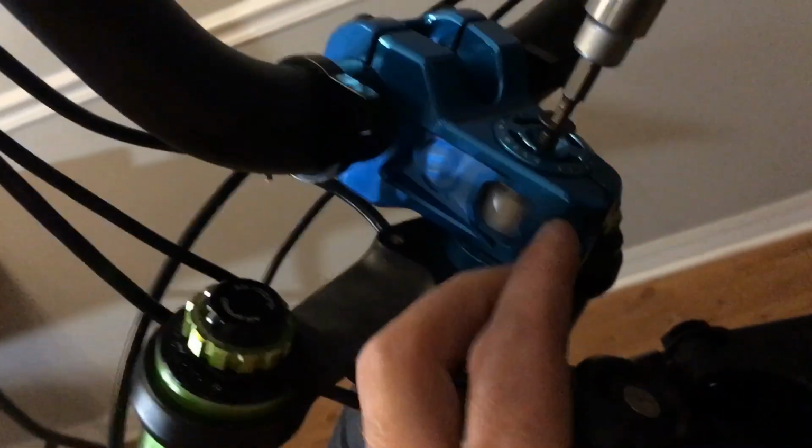So now the next step is going to be to go ahead and put this cap on, thread it down through, and then after I get it just almost to where it's starting to snug down, I want to loosen up these pinch bolts and loosen up this pinch bolt and pull everything tight, and then move the handlebars back and forth until I feel just to where it starts to have a teeny tiny bit of resistance. That means it's pulling all the bearings up tight.